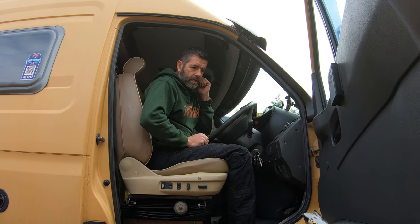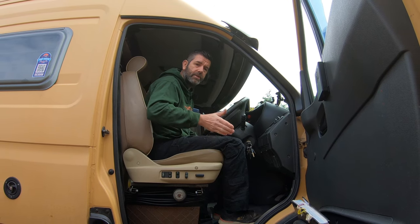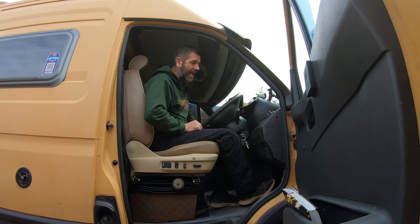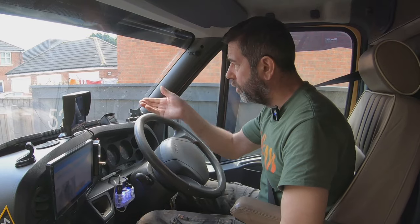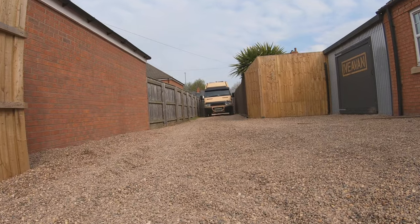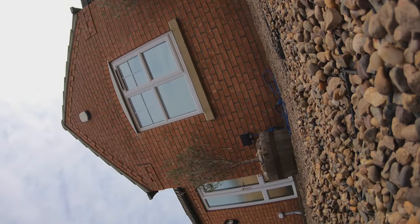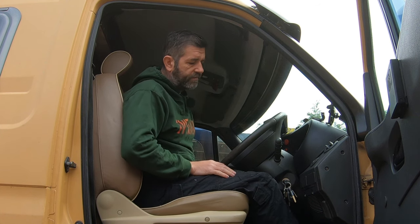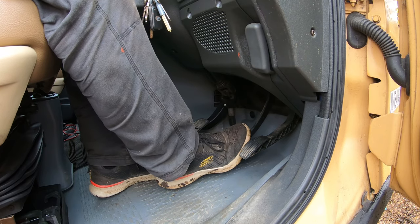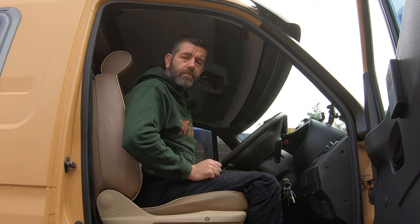The way the Iveco Daily dealerships do it is plug in an easy scan tool within the diagnostic port, then go through the brake bleed process, because it operates the ABS pump fitted on the van. The other way you could do it, if you've still got a spongy brake pedal after bleeding the brakes: find yourself a nice quiet gravelly road — luckily I have a long driveway. Just drive along, don't have to go too fast, and stamp on your brakes — apply your brake sharply so it locks up until you can feel the brake pedal vibrate due to the ABS kicking in. Turn your engine on and off again, give your brake a couple of presses, and that should give you a firm brake pedal. What it does is operate the ABS system and pump up the brake fluid within the ABS system.